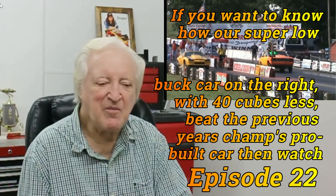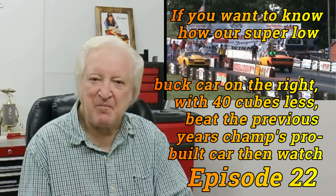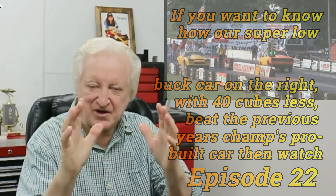My contacts at Ford filled me in on the picture. The block is actually vibrating lengthwise, and the caps are flexing — imagining the block upside down. They're not being pulled out so much as being broken by flexing. And this makes the primary fixes much easier than you might think. Let's look at those first.